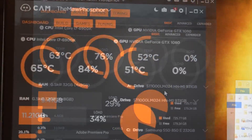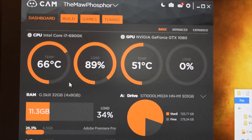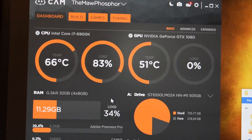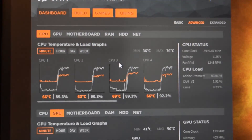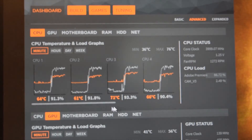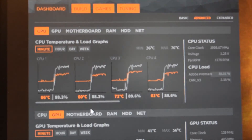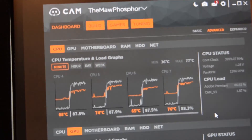Now because of the way H.264 encodes, it doesn't utilize all of the threads of our processor. This has eight cores and 16 threads and it uses about 80 to 90% of the CPU, which is still really good. It's overclocked to four gigahertz, but that is about as high as I can possibly go without messing with the voltages on that cooler — it just gets really hot, getting to about 79 degrees. In the advanced menu you can see the orange is the temperature and the gray is the load, and the load is distributed evenly on each core.